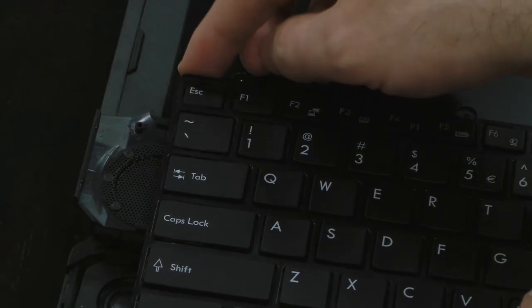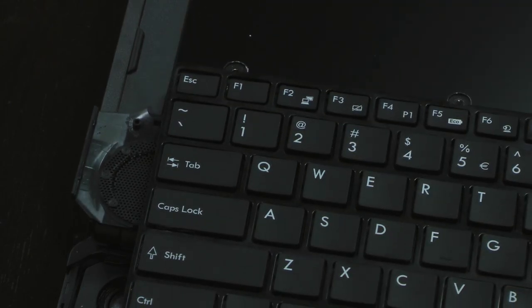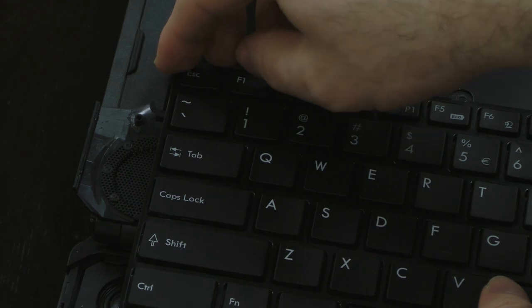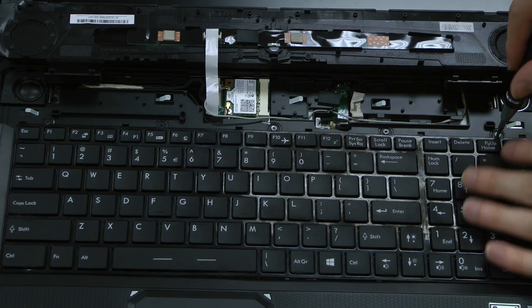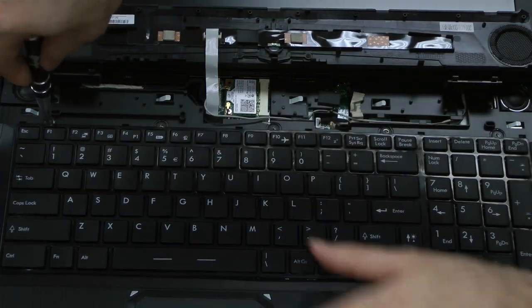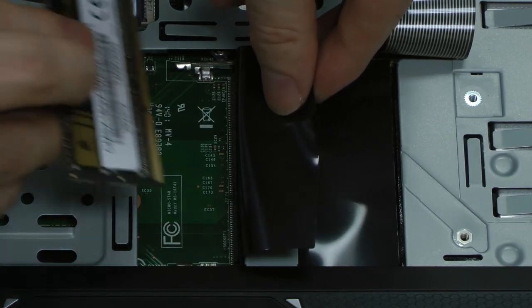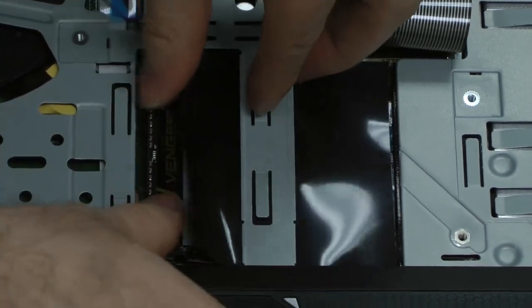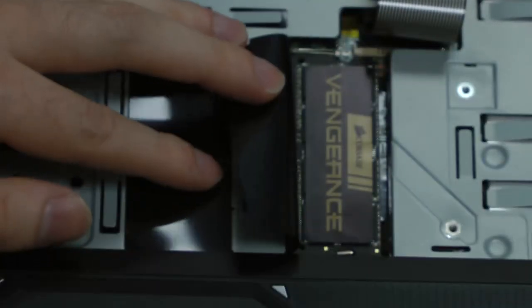The two remaining DIMM slots are actually beneath the keyboard, and unfortunately MSI's included instructions are actually wrong and can damage your notebook. The instructions tell you to find the five wedge points under the keyboard and tilt it up, but this will actually damage and remove the frame of the keyboard. To install memory to the two DIMM slots under the keyboard, you should have the top panel already removed. Then unscrew each of the five retaining screws that hold the keyboard into place and gently slide it out. Note the tabs at the bottom designed to sit under the palm rest. The two DIMM slots are hidden under film beneath the keyboard. To install memory, just lift the film for each slot and tilt the DIMM into the connector, then press down on the DIMM until the side tabs snap into place.